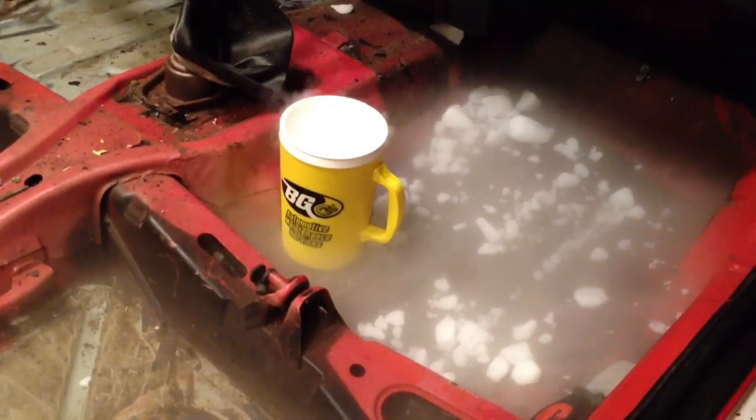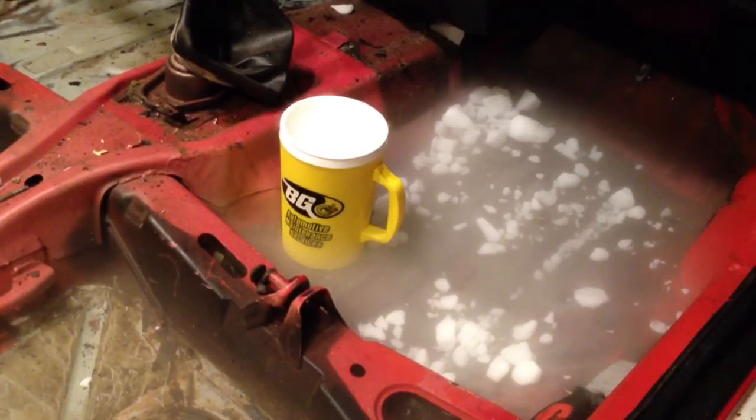Maybe if you let it sit on there till it was fully gone it might work, but it still seems like it would be a lot of work, whereas the heat gun was just heat up the dampener and scrape it right off — it took maybe 10 minutes to do a panel the size of what you're looking at. So I'm going to call the dry ice way a no-go for me. I would just rather spend the 10 to 20 minutes scraping it and be done with it. This has been Charles for HumbleMechanic.com — if you have any questions, email me at charles@humblemechanic.com. Thanks for watching.